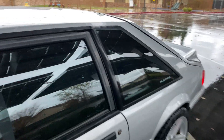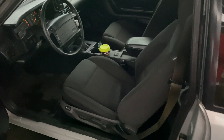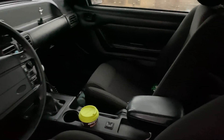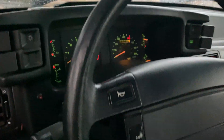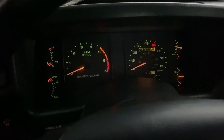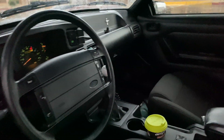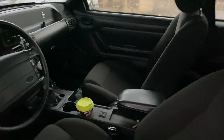It has 18x9s in the front. The interior is still the same — it has 2014 Coyote seats; myself and one of my friends made the rails for it. It has the SV cup holder, the LMR cup holder, and Coyote seats. It has a V8 gauge cluster, but I had to put the four-cylinder speedometer back in because the V8 one was messed up — so I just swapped the speedometer and tach. Other than that everything works, but the speedo is pretty off.